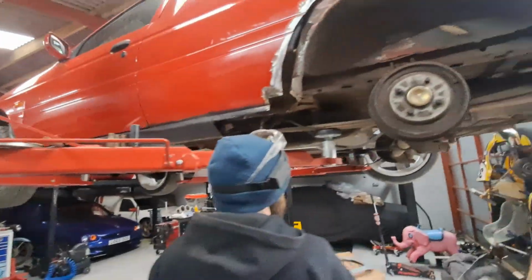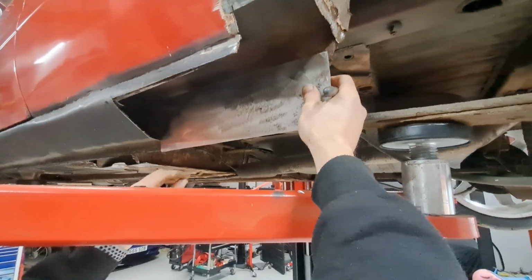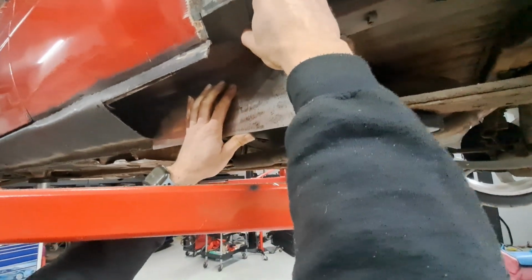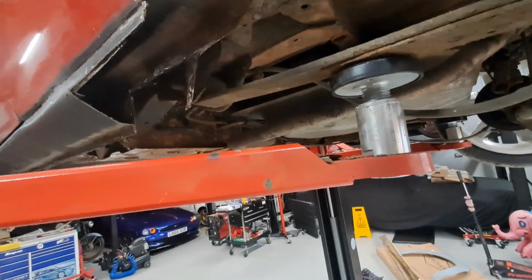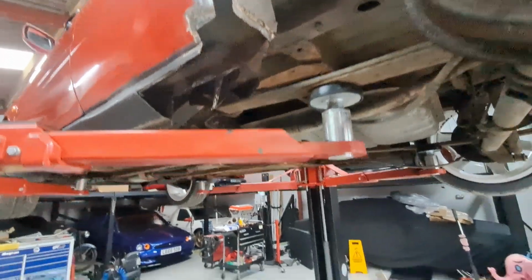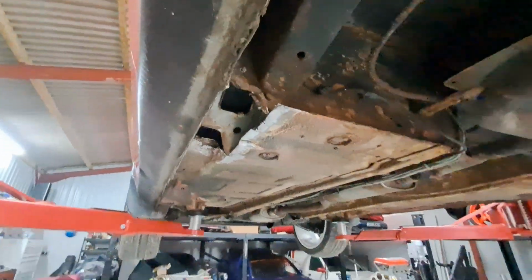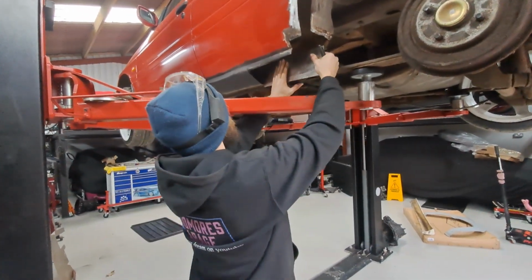So see his OnlyFans. But we're cracking on with the van. We decided to cut the outer sill off to get to the inner sill, because it was the only way really. Basically you have your inner sill, your outer sill, and the middle part of it. So we're banging a 2mm plate in there, because we're not going to have to replace the centre part of the sills. It's double skin, so you're not going to just bang up two skins on there. So got a 2mm plate on the inner, and then we'll put the outer back on and finish the boxing up. Oh yeah, carried on down on the inner sill a bit as well. So that's linear stuff. We'll plate that up as well. So we're getting there, aren't we, Skid? Getting there. Skiddy's come to visit me for the weekend, so he's giving me a hand.